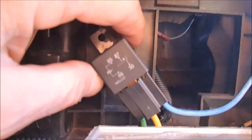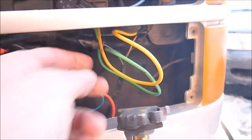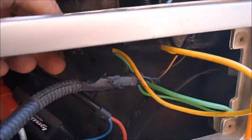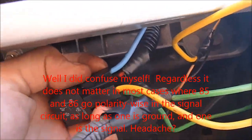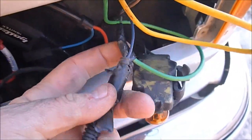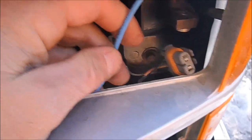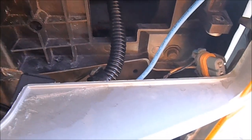Now, very quickly to summarize: pin 30 on the relay goes to a constant power source — that red wire back there is where you're picking up your power from. Pin 87 on your relay is going to go down to your low beam wire, which is just over here; on a GM that would be the tan-colored wire. Your signal for the relay to switch on and power that low beam when the high beams are on is going to come from pin 86, which is the green wire over here — that goes to the corresponding green wire on your GM circuit. Pin 85 on the relay goes down to your ground. I'll make a diagram after to make it more self-explanatory. Confusing yet? The diagram will show it all. Let's take a look and see how it actually works now.